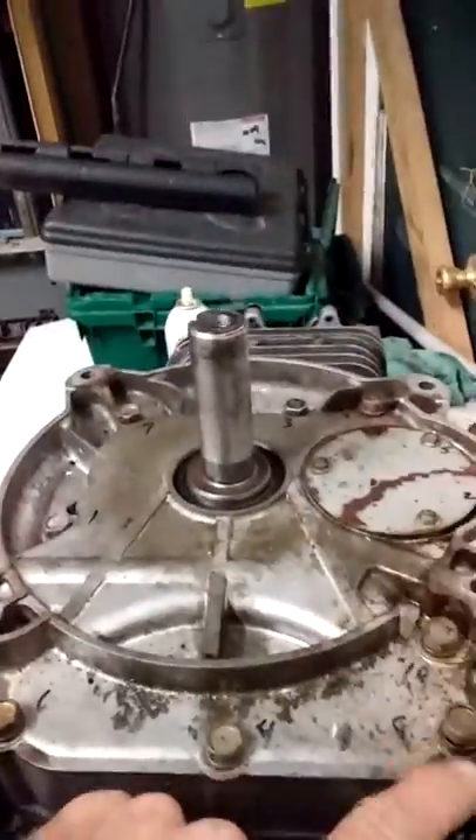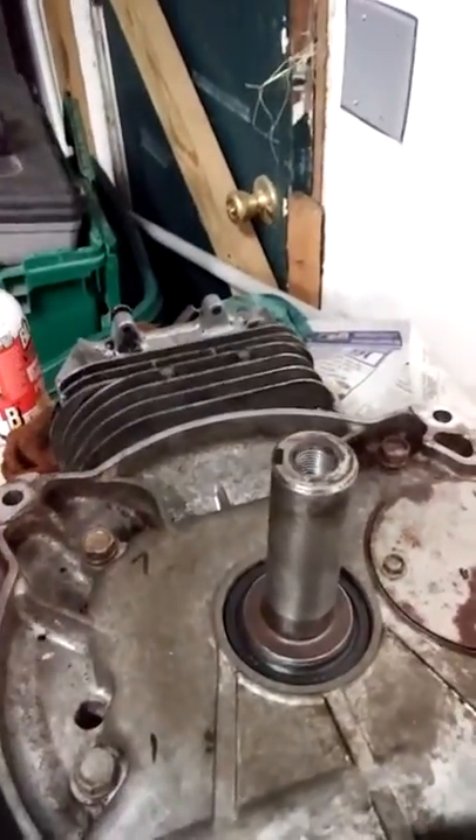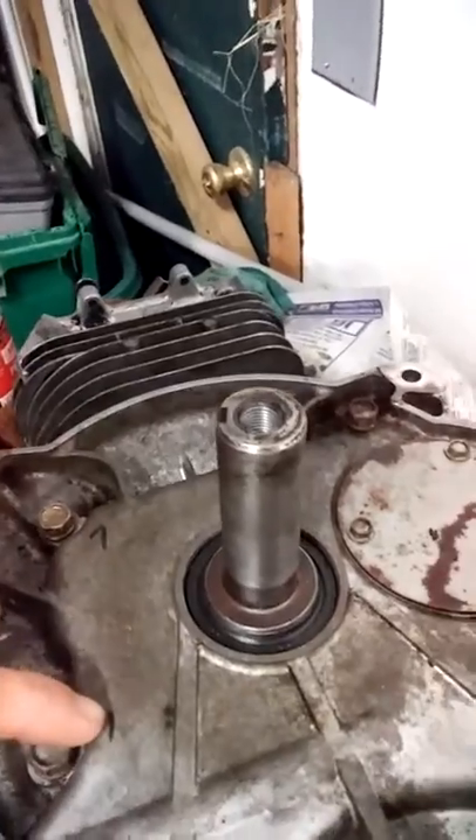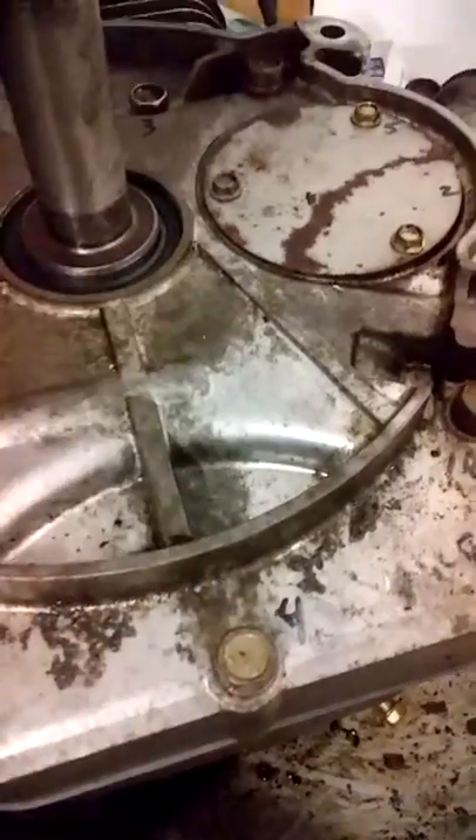I have assembled it and all case bolts are in. I need to put this one down just a little bit, get it snug — you need to get them snug. I went ahead and labeled the bolt pattern, how you torque it down. You got one right here, two's over here, three's up here, four's down here, five is right here, six, seven.